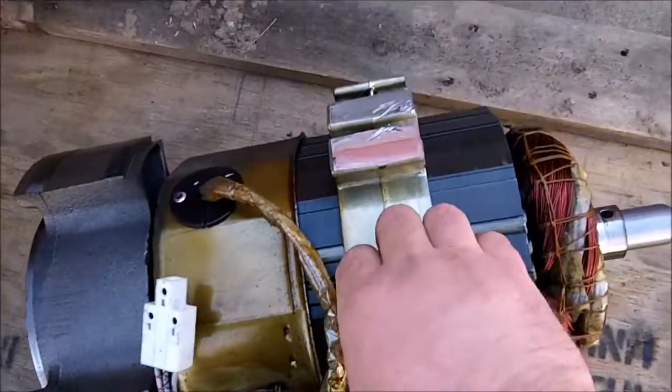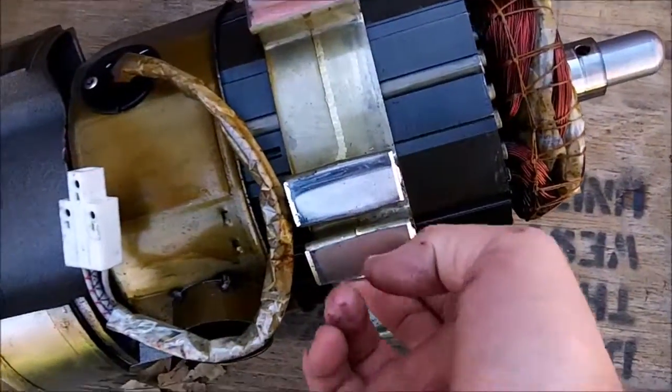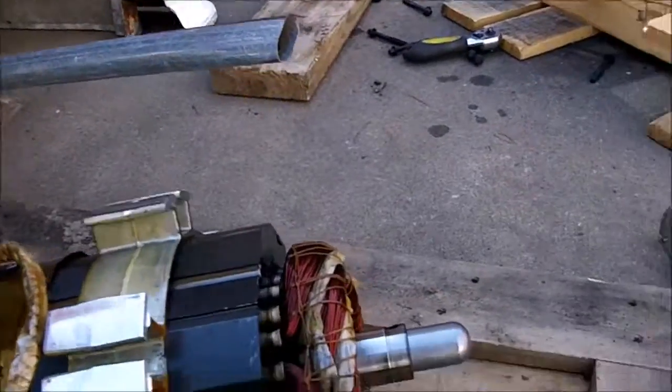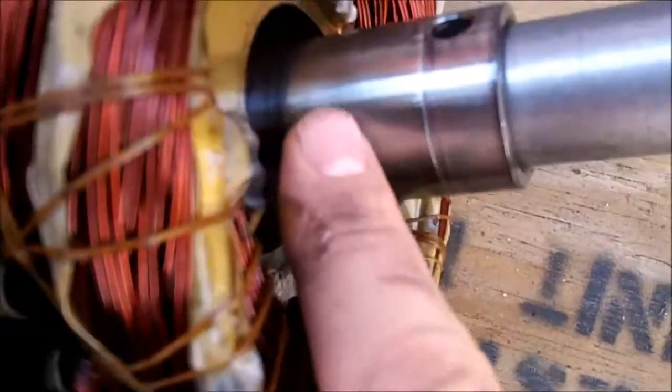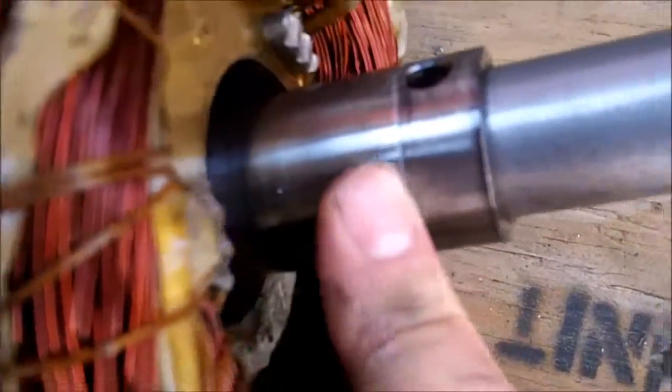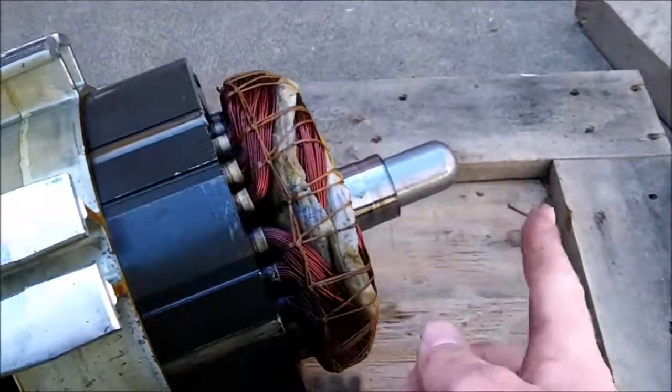You also have this aluminum retainer, which is like piston fittings where it just presses into the whole housing and keeps it centered. You can see more counterweights in the rotor shaft right here. This is where your bottom main bearing is, and this is your oil pump — it's just a spiral screw in there. You can see it right there; it goes right out the top of the rotor up here and into the moving scroll. There's just a spiral in there that sucks oil up and sprays it into the bottom of the housing.